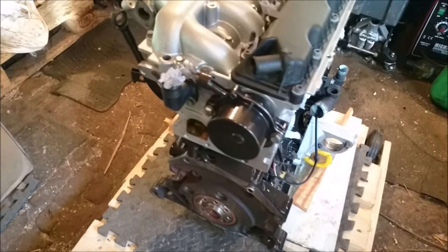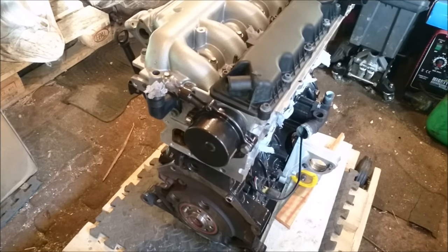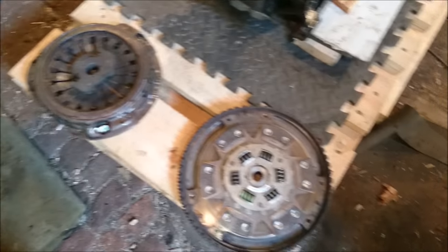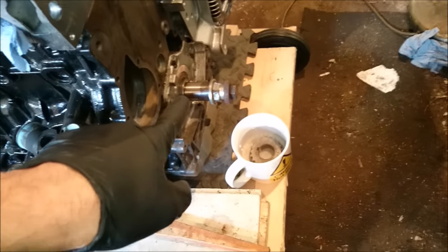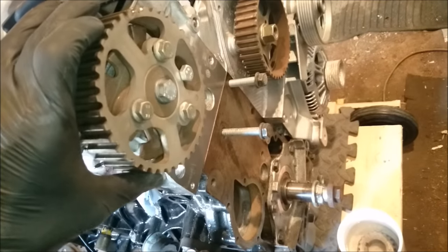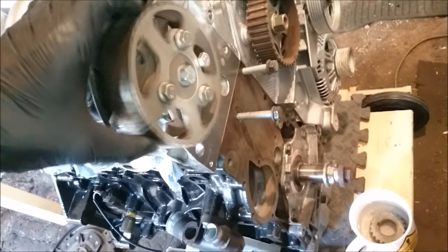I've added a few bits and bobs in the interim - the vacuum pump is on, the little breather elbow seals up the top end of the head, and I've put the bungs in a couple of them. We've put the crank seal in, cleaned up the flanges where the gearbox is going to meet, and cleaned up the clutch. The rear engine mounts are on - just useful for keeping it in position - with the Powerflex yellow bush in place; they're not making red ones at the moment. We've got the replacement cam wheel in place as the old one had the timing pin broken on the 2.2, so the 8-valve one fits perfectly. We've put the cam seal in, which wasn't in there before, and also put the glow plugs in - they were all tested fine.